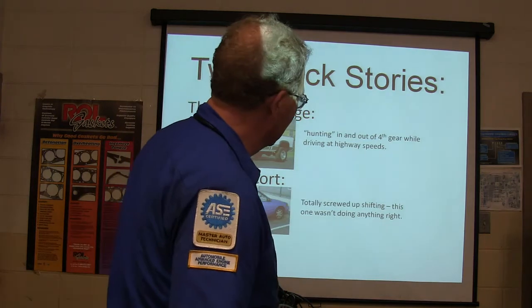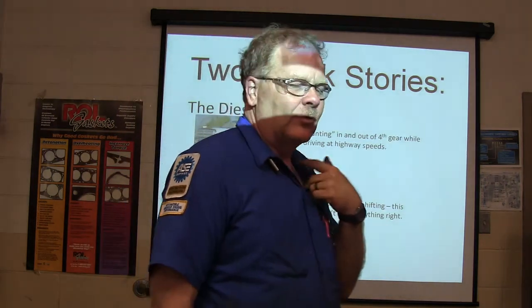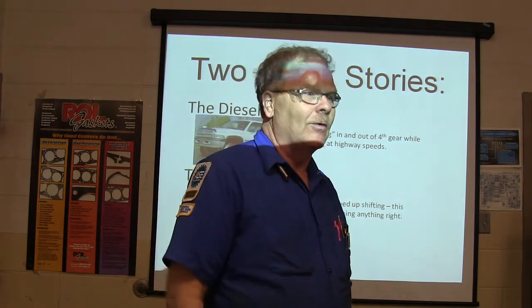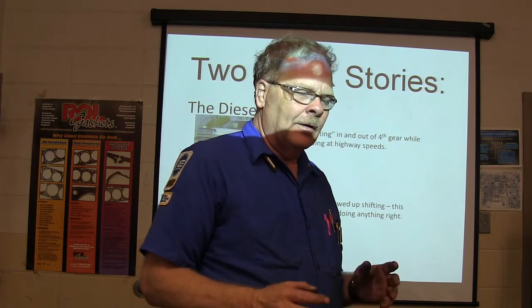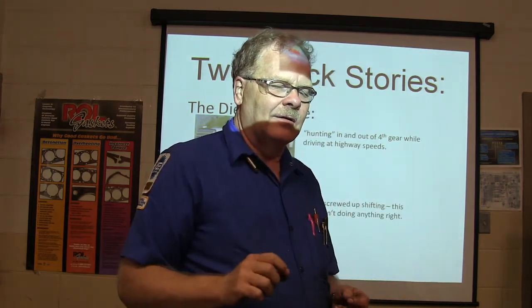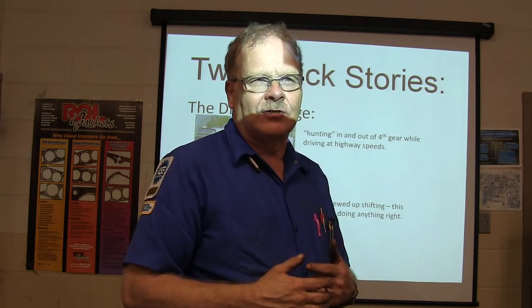Now, this one right here was totally screwed up, shifted. This one wasn't doing anything. And Kevin tore the thing apart and rebuilt it and messed with it and got himself all screwed up in the head trying to figure out what was wrong with this thing. Nothing wrong with it on the inside. And so what I did was I built him a little box so that we could tie in each one of the solenoid wires, and it would light up the little LEDs on the box as the solenoids were energized by the engine controller.